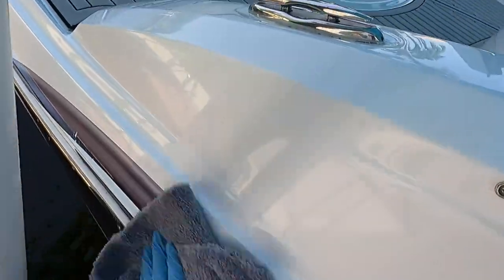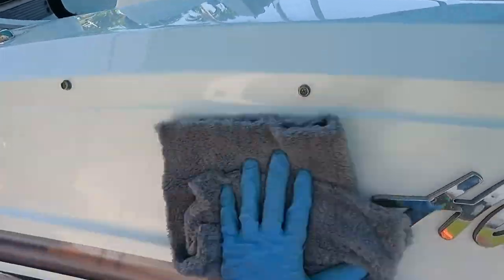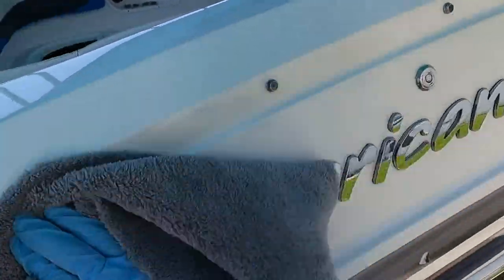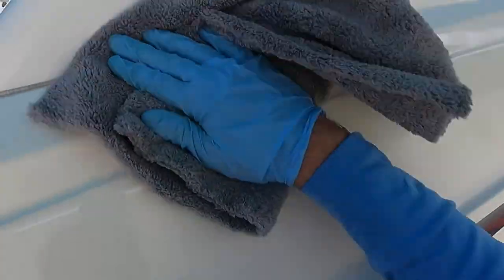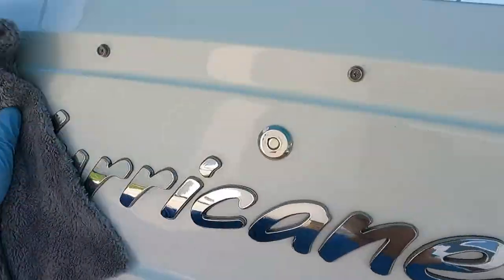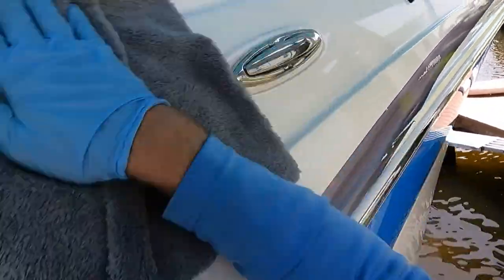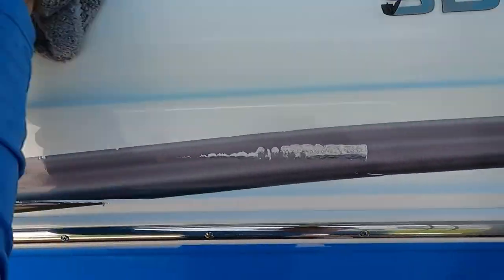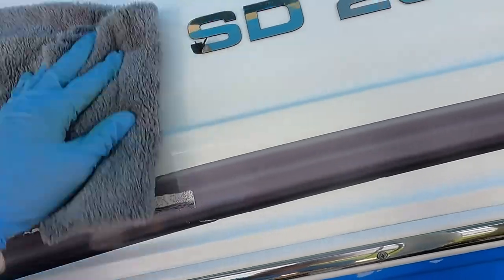Really time this up — do about 30 minutes of work in terms of application, and then once that 30 minutes is up, come back and wipe off what you just applied. In a different situation — out in sunlight in the 90s with a little oxidation — you could only wait 10 minutes. So you'll get about a 10 to 30-minute time frame. In a storage building you might get 45 minutes to an hour, and in a winter storage building in a cold climate you could probably get up to an hour for this to cure. Heat and sunlight lower the time; oxidation lowers the time. Cold storage, wintertime, no humidity — this extends that window. So you've got about a 10-minute to one-hour time frame depending on conditions.